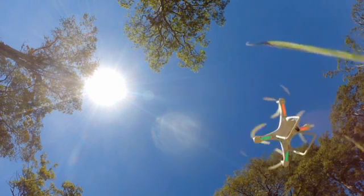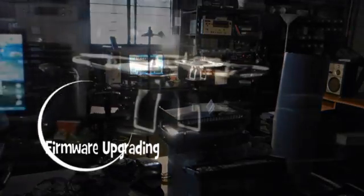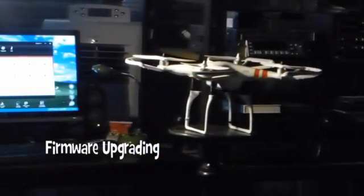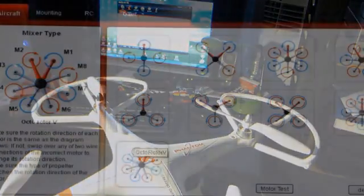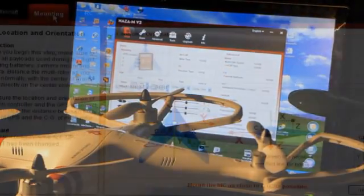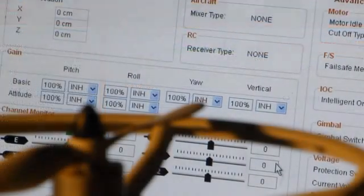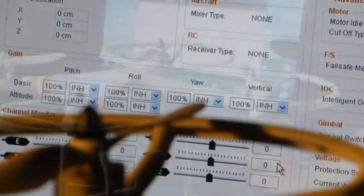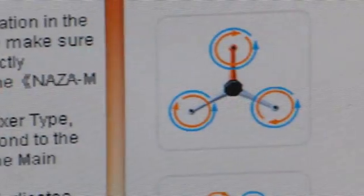The Phantom 2 definitely has some going-home issues, but more on that in another video. The final thing is firmware upgrades — they are really important, but this is where a lot seems to go wrong. If you don't know what you're doing, don't do it. Get your local Phantom shop technician to do it for you; they'll know what updates and IMU alignments need to be carried out. If you can't get it to them, post it. And remember: after a firmware update or getting it back from the dealer, it's back to the start — set your compass again and work through your flight checklist.